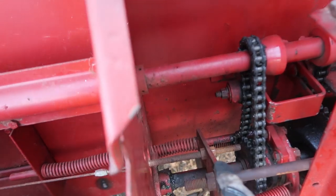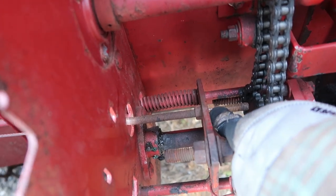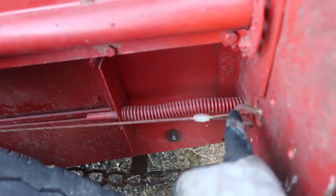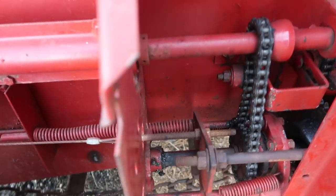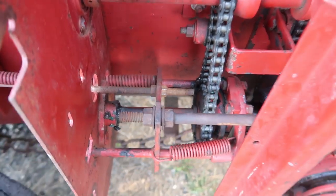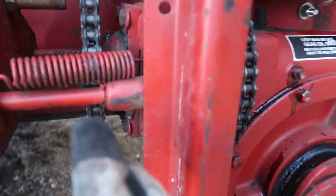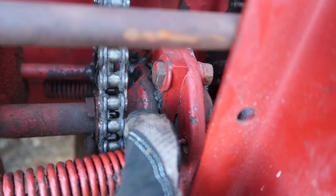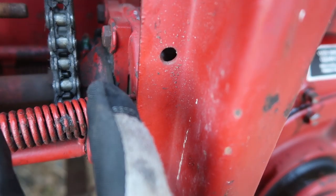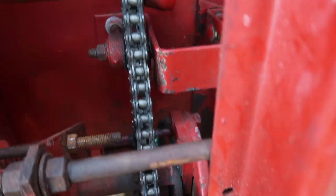We were able to put this exactly back where it was. To get the wire off, Eric ended up taking this nut off right here, and then this could back off. We slipped the wire off. The back nut we left so we knew where to back into. We've got two different sandwich plates that engage with each other — one right back here will open apart, and you have to make sure they engage back together in the right spot, otherwise you're going to have some issues. Which we ran into.